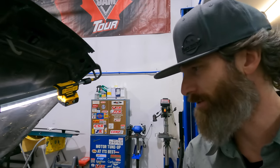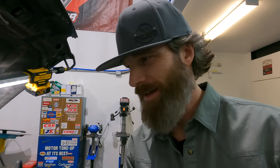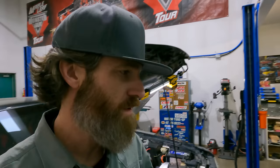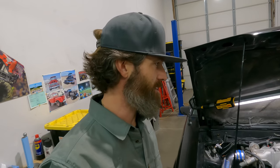I think we're in a better spot than we started out. I mean, it is a little bit of a rat's nest. A lot of the vacuum plumbing has been deleted. So you're kind of making the best out of a bad situation, I guess you could say. But I think we've got it back to as close to OEM as possible with what I had to work with. All right. So, anyway, the new MAP sensor's in, the EGR vac solenoid is in, and I think we're ready to hook the battery up and shake this thing down.